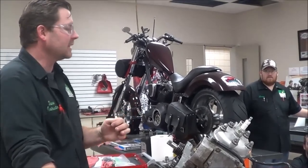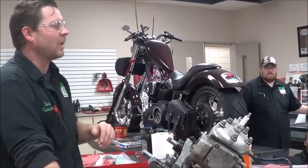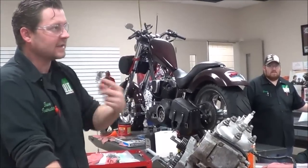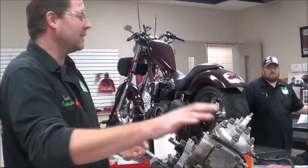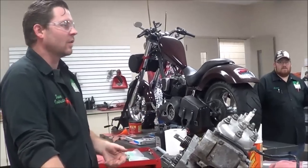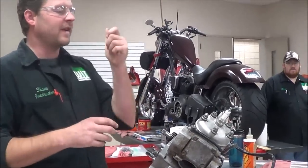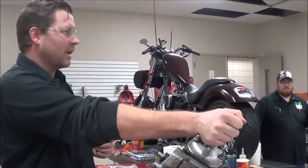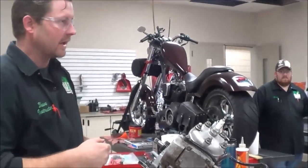A lot of times you have technicians come in, they'll say, hey, I can't get this snowmobile running, or it has weak spark. If you can't spin it fast enough, it's going to have weak spark. The same thing on this dirt bike. If you go to kick it over and you got a sore knee and you just give it kind of a real slow kick through, you won't spin it fast enough to give it a good strong spark. So those are some considerations we'll get into when we do electrical. Sound good?